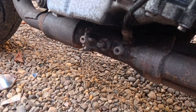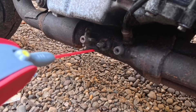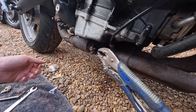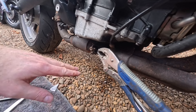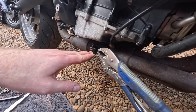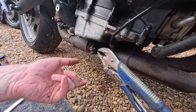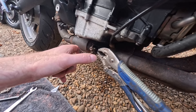Well that's the spring — that's just hit out of space. Oh that don't look good. I suppose I'd better try and find this spring first. So guys, as it stands at the moment, I just wanted to double check my own theory. When the bike is off, the valve inside is parallel to the floor — i.e. it's open. When you turn the bike on, the flap moves to almost a perpendicular position, probably about 30% left open. And then when you go full throttle it starts to move all the way around — I believe that is correct anyway.